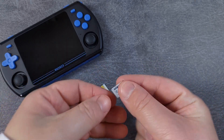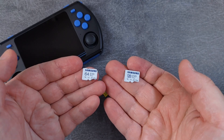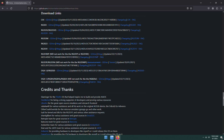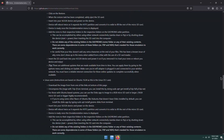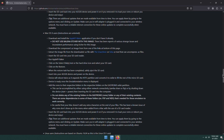Now we need to copy this image over to our new SD card. Insert the new OS SD card into your PC. It's recommended to use an SD card of at least 8GB, but 16GB or higher is recommended. There's no upper limit, so 512GB or 1TB should be fine. Depending on your PC's operating system, this process will be a little different. On the GitHub page, you'll find an instructions for loading section with steps for Windows, Mac, and Linux. I'll walk you through the Windows instructions in this video.